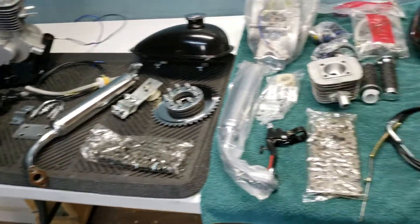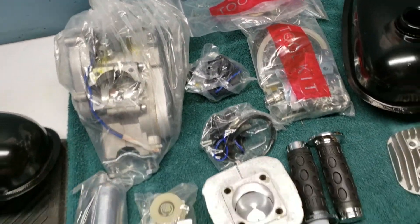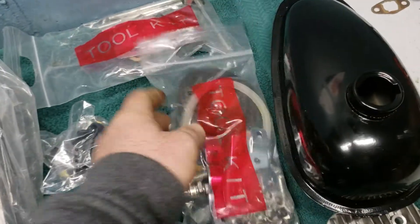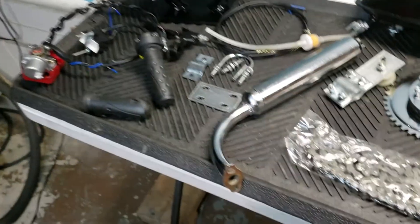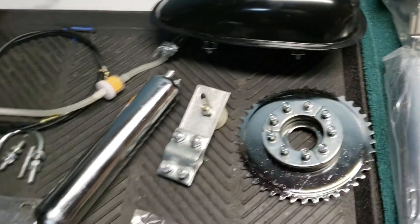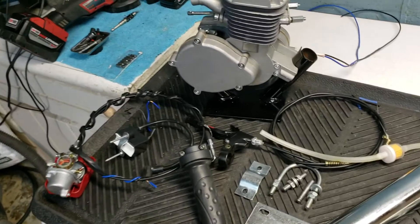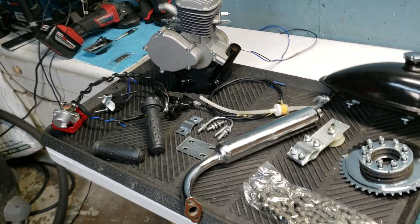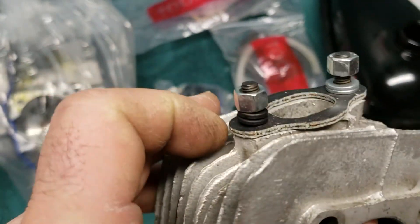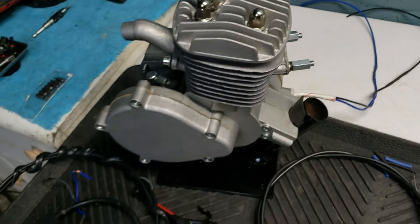When I get these kits, this is what it looks like — and if you bought the kit yourself, this is what it would look like: nothing's put together, just a tank and all the parts. What's nice about the prepped kit is everything is put together and ready to use when you put it on your bike. A couple of upgrades I do: I add extra hardware so you can double-bolt everything, especially the motor mounts and muffler mounts. These are the stock studs, and I upgrade them to longer studs and use coupling nuts — that's a really nice upgrade.